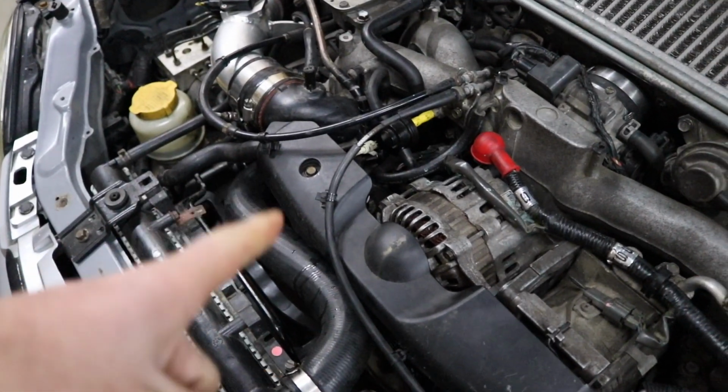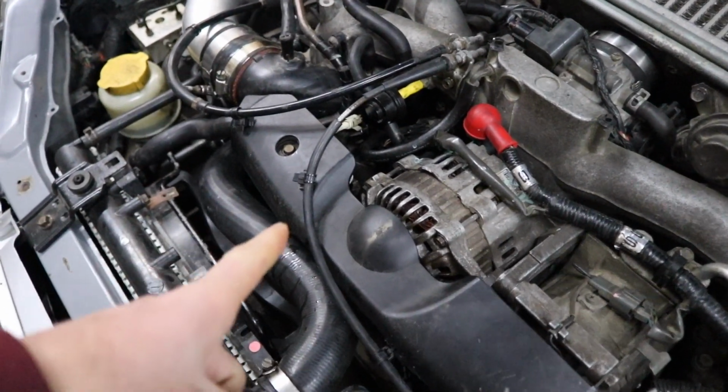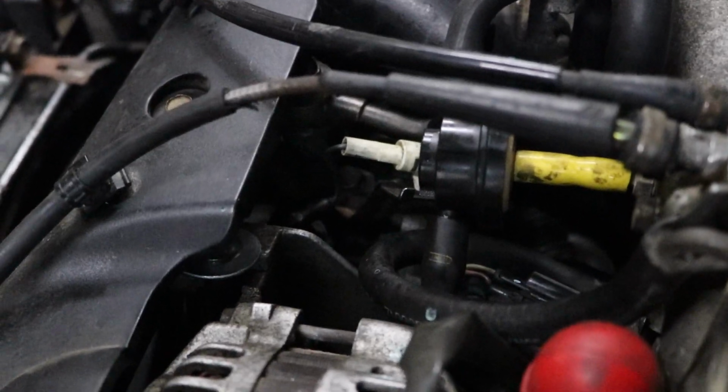And it's actually not a bad thing that we have to replace this power steering pump because the bracket on the back of the pump, which you guys can see right in there, kind of dark, but that bracket down there is broken, so I have a massive washer on it. And that bracket is just for the adjustment bolt for the alternator to set the tension on your drive belt.